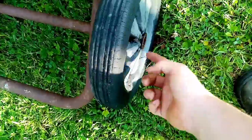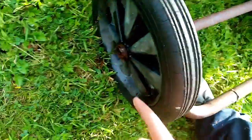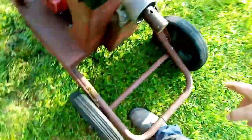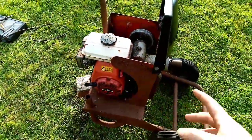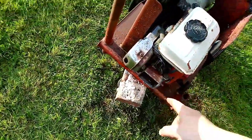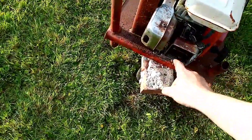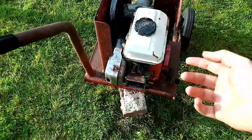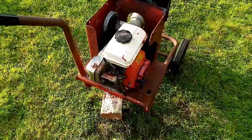I want to sort the wheels next — I got them unseized the other day. They used to have little clips on either side but now they're just running on the shaft, so I'm going to drill a little hole straight through and put a G-pin in instead. They're original so I'll leave them on it. The handle is missing so I'll make one. I need a new air filter for the back — I'll just make one out of an old sponge. Always check on these old engines: if they have a sponge filter it could be disintegrating inside its housing, and when you try to start it, it just sucks the debris and mush straight into the carburettor and engine — then you're in another ballgame.